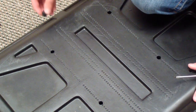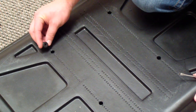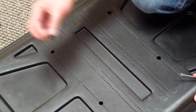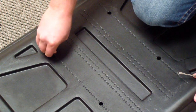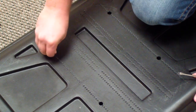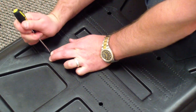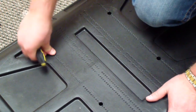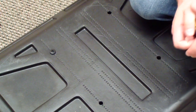Step 8 is pretty simple — we're going to install the four grommets. Since I'm using the 6-millimeter screw, I'm going to use the larger grommet of the two in the bag. You should have four of them in the small bag. The grommets are there to prevent any water intrusion that could get through the back of the television. You may need a small screwdriver to help get them in tight. Take that screwdriver, help along, and pop that grommet right in. Make sure it's in there nice and tight — that's how you install your grommets.